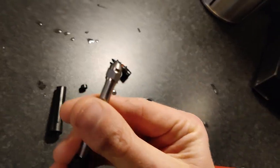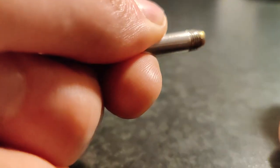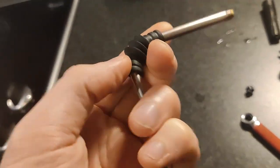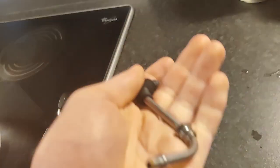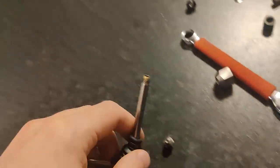Then on this one, you remove the steam end, which is threaded — the one I've got here took an 8mm spanner. And she's off. Once that's off, you put a bit of washing up liquid on here, douse it with water, and this will then slide right off. Once that slides off, you can take this out, just slide it right off, and then slide the Gaggia screw back on, put the rest back on, do it back up, and then it pretty much goes straight into the machine.